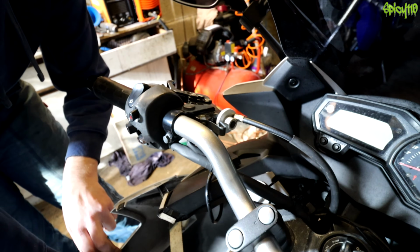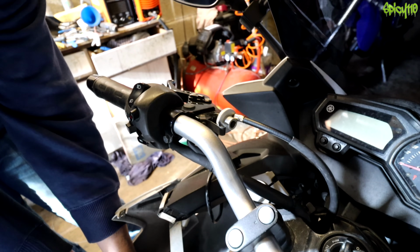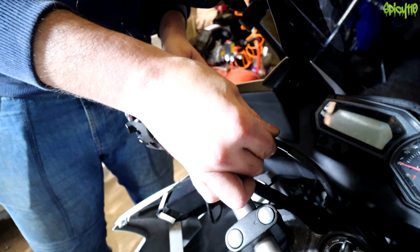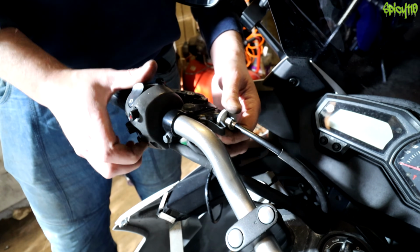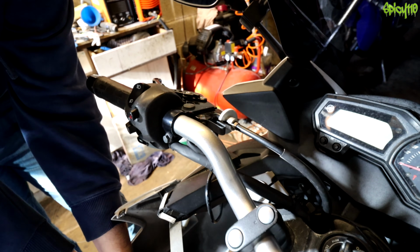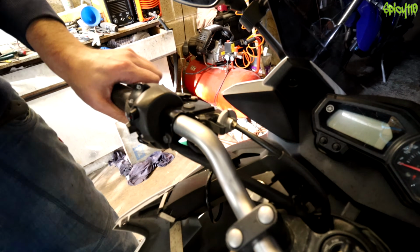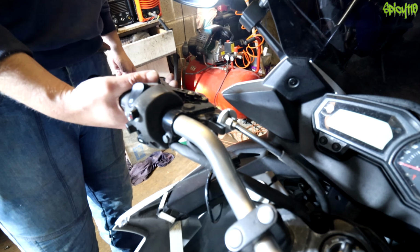Okay, right. So I've loosened the small nut that you saw. I'm now twisting the big barrel, as you'll see in a second. I should be able to get this over here easy now. There we go. Right. That's too loose. So we can now remove that length again. So we've got some free play. I mean, it's moving the clutch.